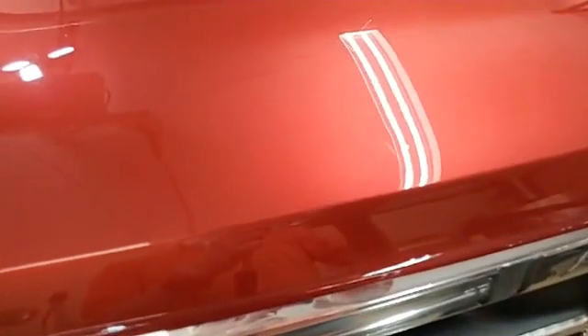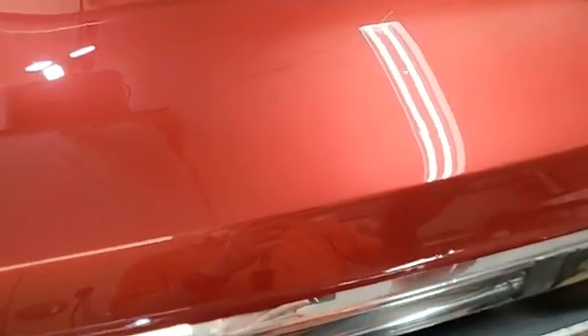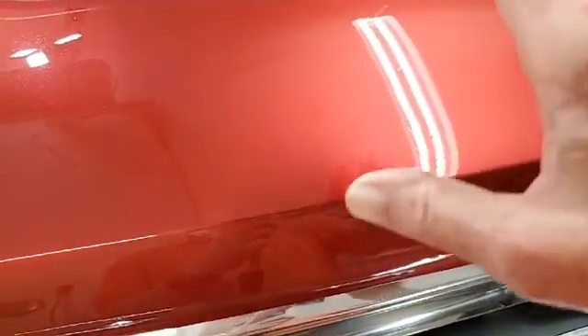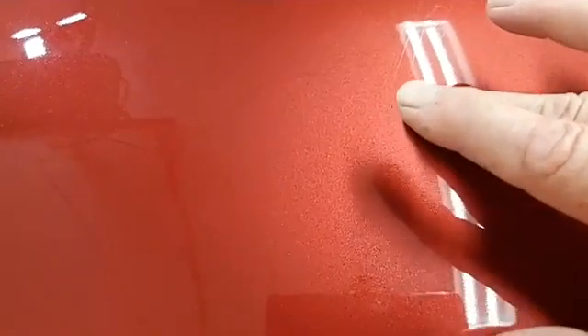We also had some deep ones down here. What I've done is tried the long throw polisher with the correcting cream and that blue hybrid wool pad — very thoroughly, very slowly, about an inch or so per second, two or three passes over this. What I ended up with — remember how deep those were — if you get up close they are still visible, but they have been reduced pretty drastically. That one was reduced even more.